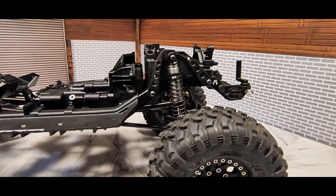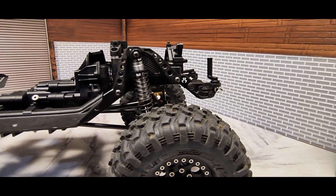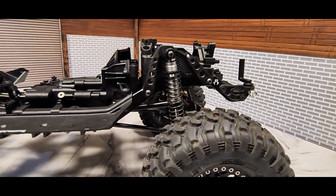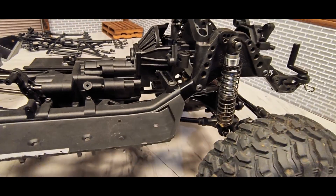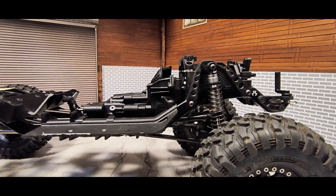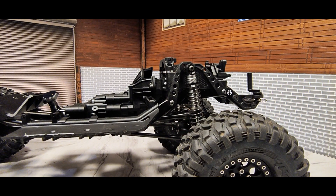In the front — and this is all just mock-up, just to kind of get my wheelbase set — on the TRX4 Sport, I did use the lower links and the panhard mount from the TRX4 Sport. The upper link I kind of made my own. The pinion angle is pretty much straight on; I could probably still adjust that but it seems to be working fine. I still haven't got the steering link hooked up yet.